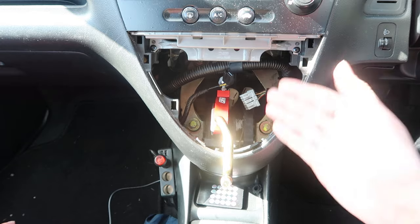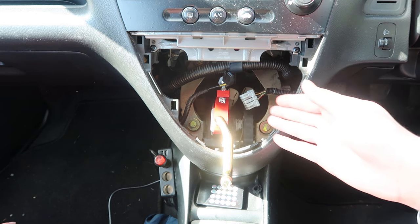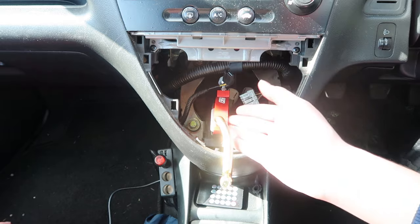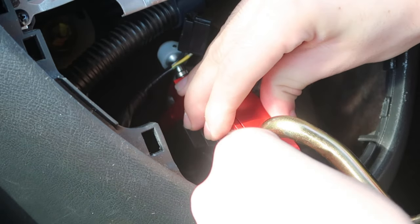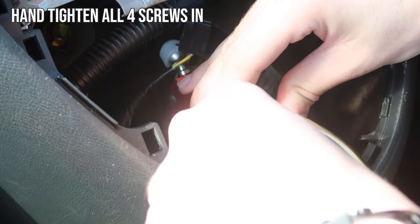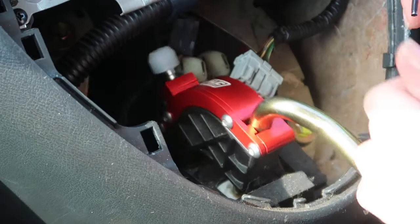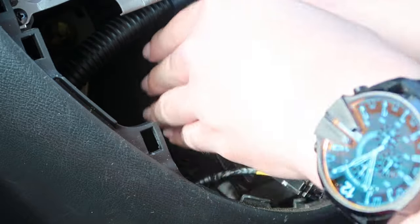That's hammered in. I'm showing you how to hammer it in, and yes it will scuff the side of the MJC - but there are two reasons I've done it this way. If you want, put something between the hammer and the shifter, or use a soft hammer - I highly recommend that. This looks very nice but it's going to get covered anyway. Next, put the cover on and screw in the screws - hand tighten first so they catch the thread, then use the included allen key to finish tightening them.